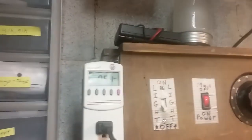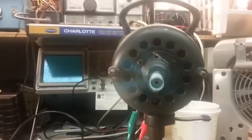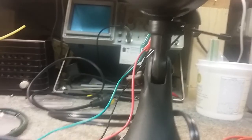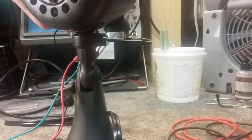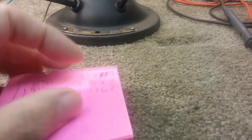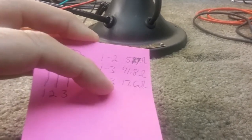It's doing fine on high, 0.51 amps. So it's drawing instead of the rated 0.7 amps, we're running at 0.51 amps, so it's running really cool. With the motor as hard to turn as it is, this should be higher wattage, not lower wattage — higher current. We're drawing 40 watts. It's nice and cool. I think what happened is somebody had connected it to wires 2 and 3, which is not used. You need all three wires: 1 and 2, and 1 and 3. You don't need 2 and 3.